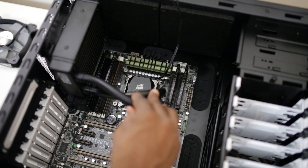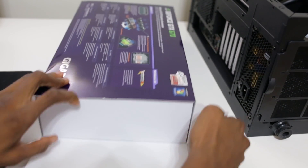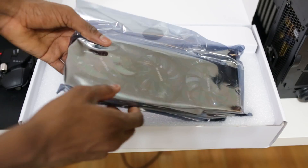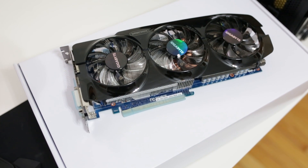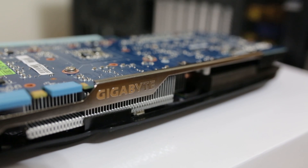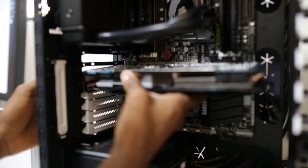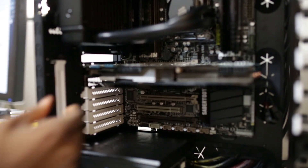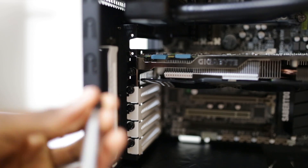Last large part is the graphics card — our Gigabyte GeForce GTX 670 Overclocked Edition with 2GB of video RAM and 1344 CUDA Cores, which Adobe programs love. This is another one of those complex and detailed parts that is almost beautiful in a way you can see from the outside. You can see the triple fan silent cooling solution that keeps it so quiet. Installation of a PCI card is very simple — you drop the placeholders out of the case and snap the video card into the first PCI slot at the top of the motherboard. Then put the screws back in to support the card's weight, since it would strain the motherboard without that support.